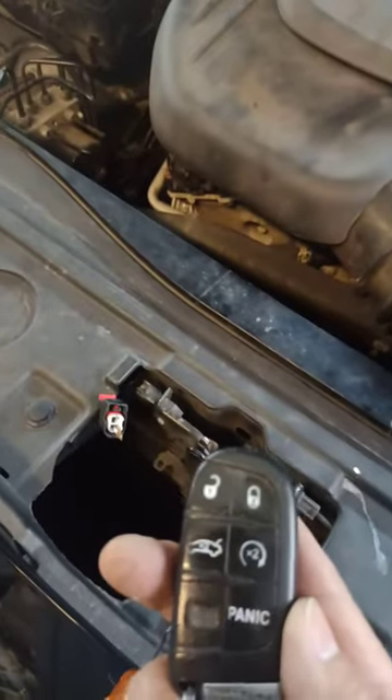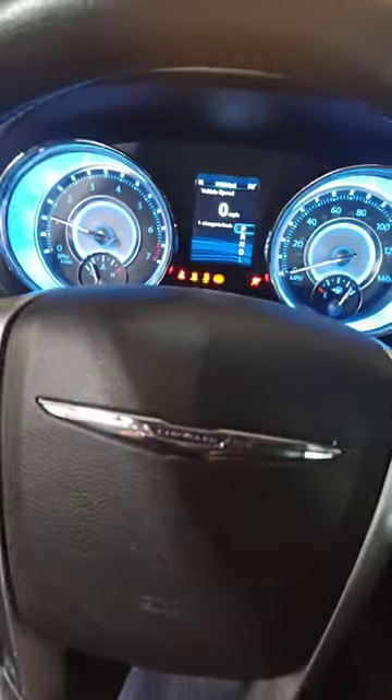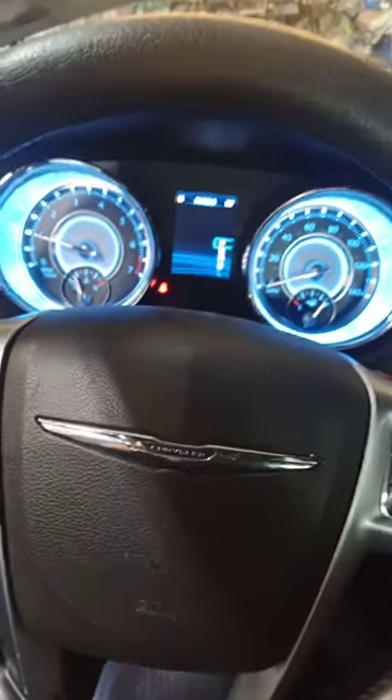Now when you do that, you have to restart the car with the key to reset the hood indication. So I'm going to go back in and start the car with the key first, so it doesn't have a hood open indication anymore. Then shut it off. The hood is still open, but I have a 1K resistor temporarily connected to the plug side.